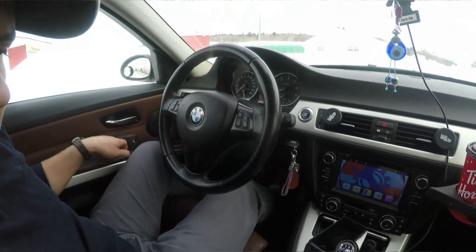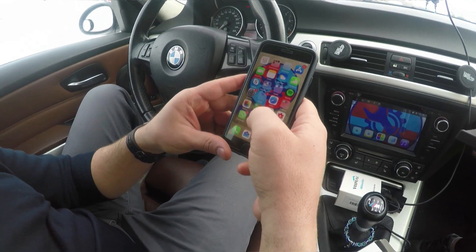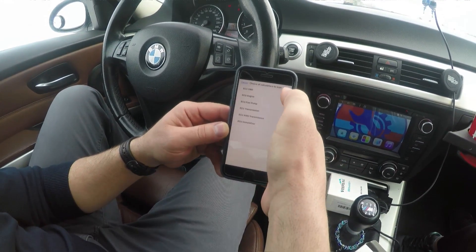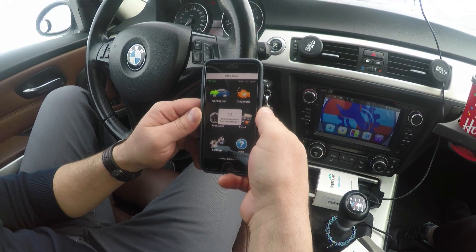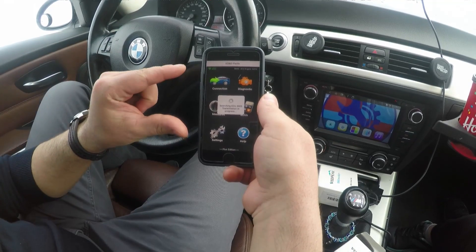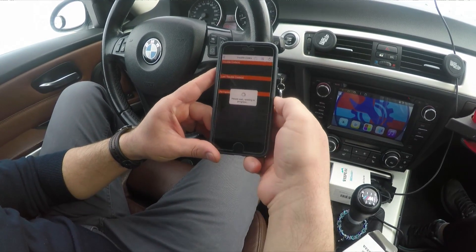The V-peak is connected. Like the other one, it doesn't give a visual indicator when connected. Wi-Fi OBD 2 connects again through Wi-Fi. I'll open eOBD Facile, connect to the car, select BMW, check-mark all the modules. The V-peak takes a little bit longer to connect to the car's computer, probably because it accesses more modules — and we'll see that we get more codes than just P0140.